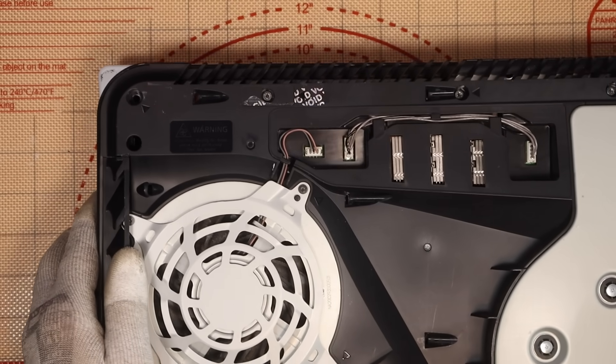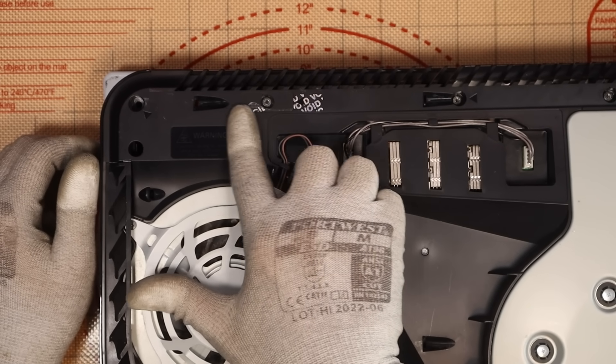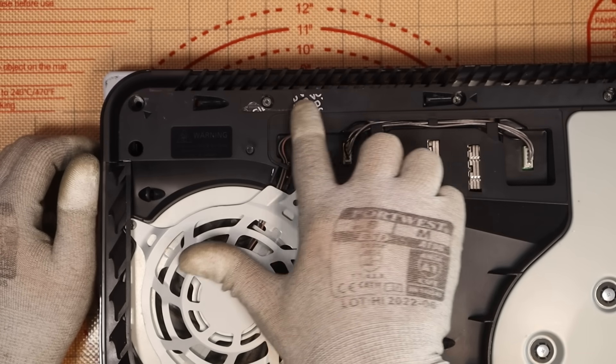When I went to reinitialize the PS5 with the update file from PlayStation, it didn't recognize the USB. It was saying you need to put a USB stick in. I've used this on multiple occasions, so it's almost like there's power from the USB ports but there's no data. The first interesting sight is that this console has had a repair — it has a voided warranty sticker that went further than where it should be. So we might have had a case of a repair that just hasn't lasted or gone wrong.